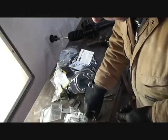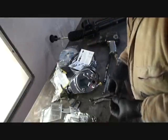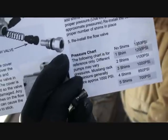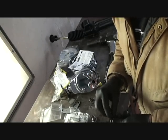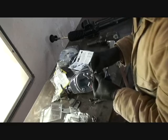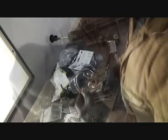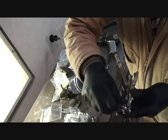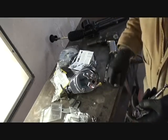The next thing you do is get your little washers, which are your shims. A Mustang rack requires approximately 1,000 pounds of pressure. Look at our chart — it's going to tell you the pressure per shim. It tells you exactly what a Mustang rack takes. Mustang racks are the most common use for these valves, because that's usually what everybody changes their steering over to. We're going to put three shims on there — three shims will equal 1,000 PSI.